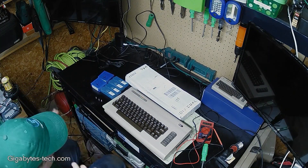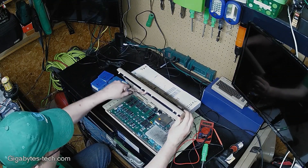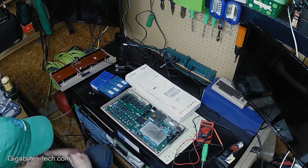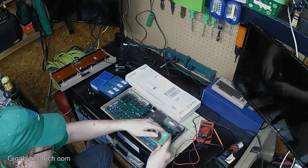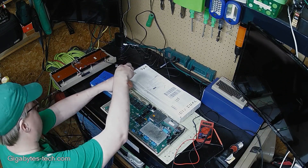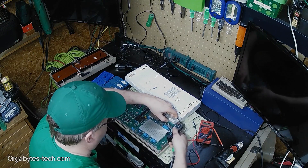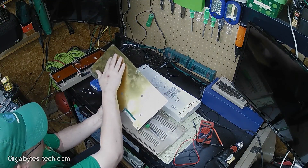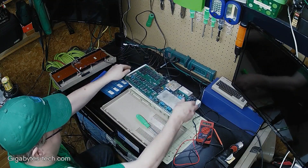So we'll set that aside for now, because right now we need to get into the nitty-gritty of it. Pull this Commodore board out. Now this is the same Commodore that I redid the keys on the keyboard with — you've seen this in one or two other videos. Let's get to the task of removing this board. Of course, I made that composite video cable. The Mark II already has an 8-pin cable, so I can actually use my 8-pin on this new board. What might surprise you is that I should be able to use the 5-pin cable that I made as well. This whole thing lifts out just like that. It's still got the original shield here. There are a lot of fingerprints all over the bottom of this shield — I'm guessing it has been taken out once or twice before. I'm going to get a couple of static bags and wrap this up.